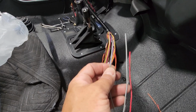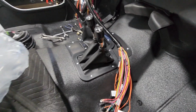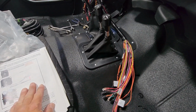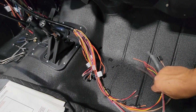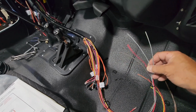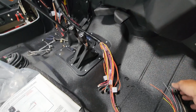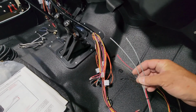906 is actually an extension of that wire. Let me just make sure I don't have those numbers backwards. Excuse me, I do have them backwards. 906 is in the passenger compartment and it comes off the fuse panel, and that is for a switched accessory inside the tub. If you're running an air compressor in here and you need to switch a relay or something of that nature.